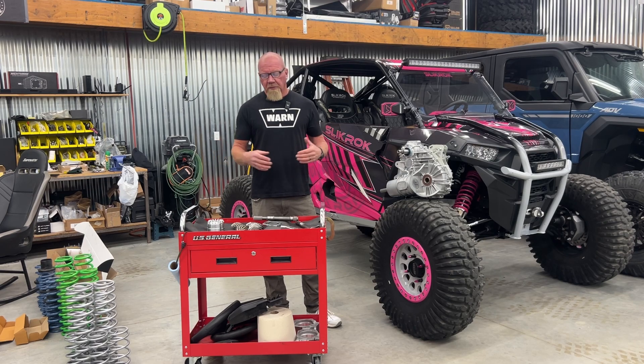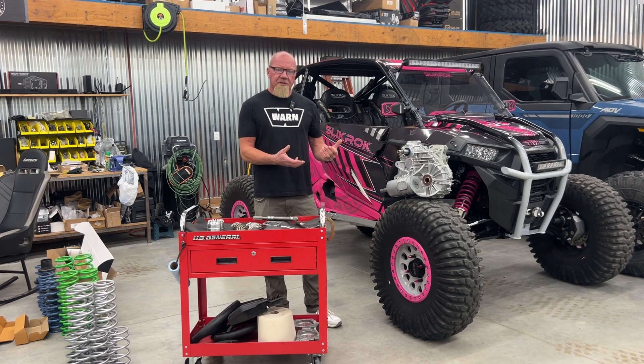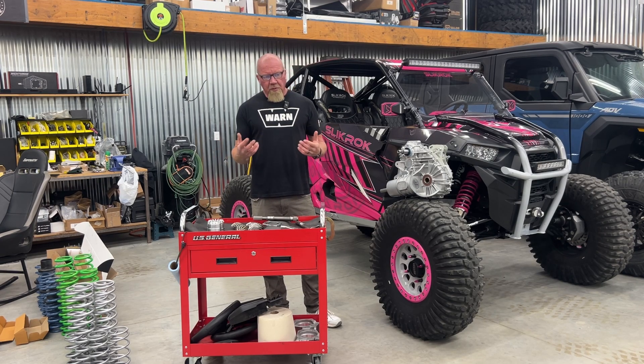So if you're running a lot bigger tires like we do, going to a lower gear in the transmission makes it perform a lot more like an OEM-style car does. The mud guys like that, the rock crawlers like that. If you're running an oversized tire, we highly suggest you get a gear reduction in there because it puts a lot less stress on the components.